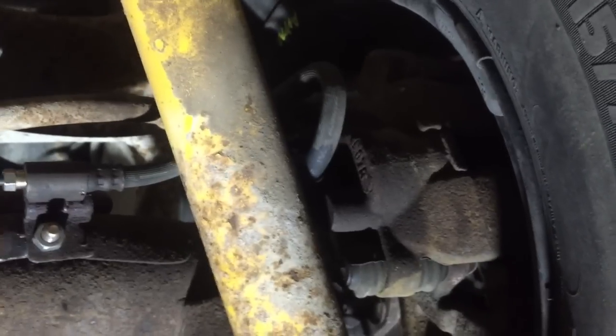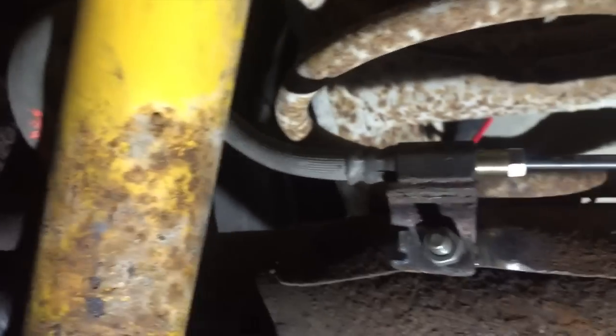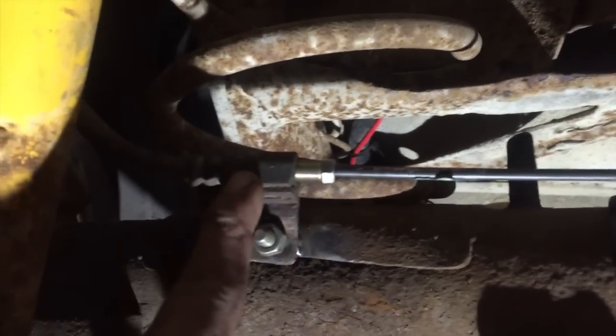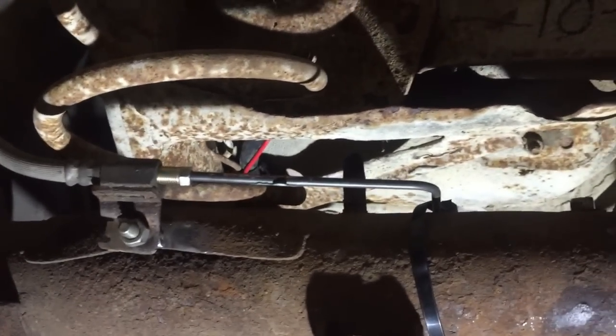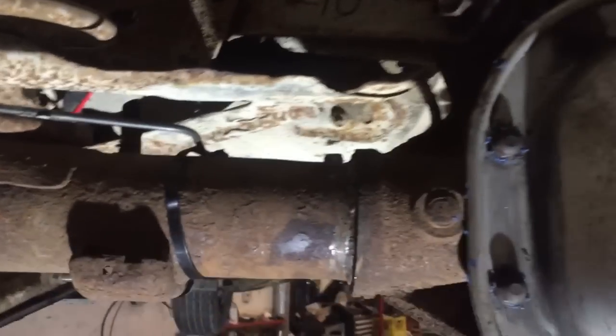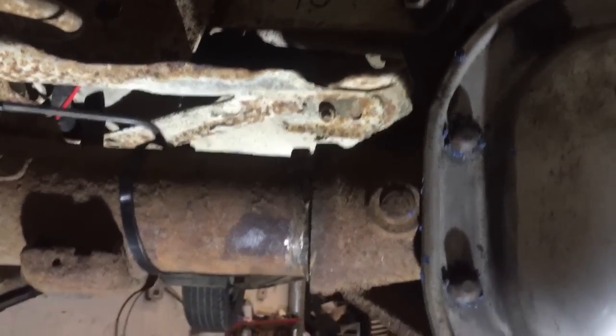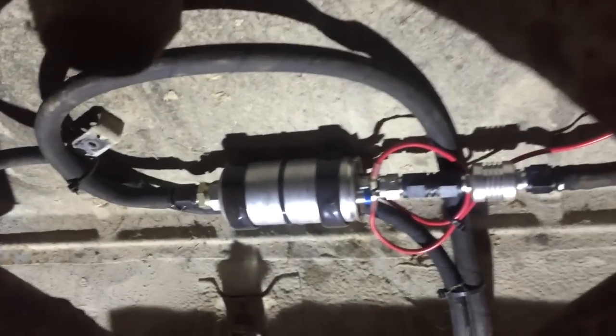Stock brake line on that side. When I was at the junkyard I always try to get two passenger-side brake hoses, because on these the brake hose normally goes to here and then the same hose goes off to the frame. That doesn't work most of the time because you want to use the brake hose that came on the car so you don't have to mess with the brake lines on the body side — anytime you deal with rusty old cars, the last thing you want is messing with stuff you don't have to. I just welded a bolt to the back side of the axle tube and that's the factory brake hose that goes up from there.